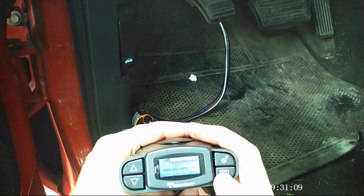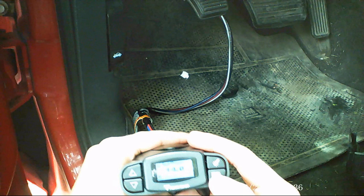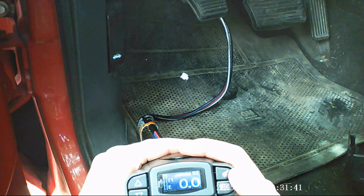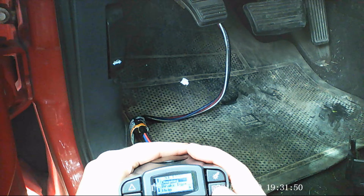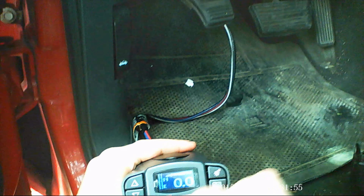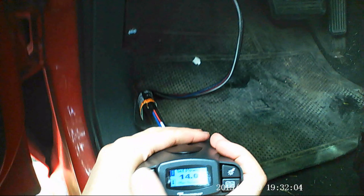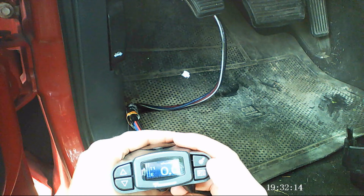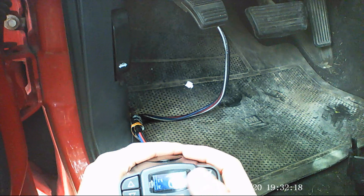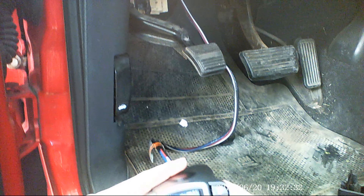If you hit contact us, it has the website right there. It'll go from zero up to 14. If you hit the boost right there, you can set boost level 2, and you can go back through this — 14 is the max. As you adjust the boost, it is changing the picture of the trailer that's shown on screen. You're setting the power that it's going to be giving to those electronic brakes. We're going to put the max output and select that, then find a place to mount this on the dash and go over how to program it.